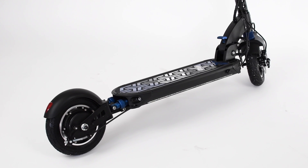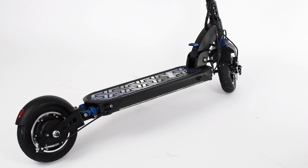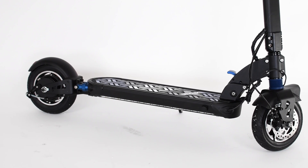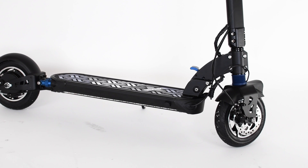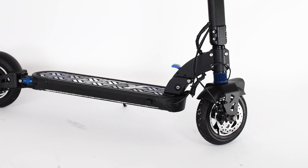The Polo City comes with front and back 8.5 inch pneumatic tires, with dual suspension — hydraulic in the back and spring in the front. This overall combination really adds to great suspension and overall comfort during your ride. It also comes with a rear drum brake, which is great because dirt and anything else can't damage it, and a front disc brake for additional safety while driving.